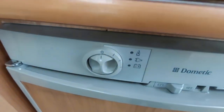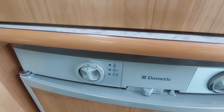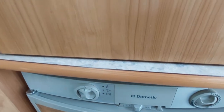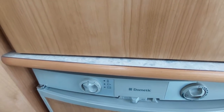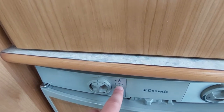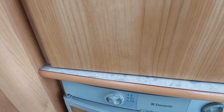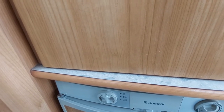The first icon — a little triangle symbol — indicates a flame, and that's for running the fridge off gas. You've then got a plug icon for 230 volt, and then a 12 volt battery symbol for when you're running it off 12 volts. You run the system off 12 volt when travelling because there's a built-in alternator which powers the fridge on the move. When you're on site run it off 230 volt, and when wild camping run it off gas.